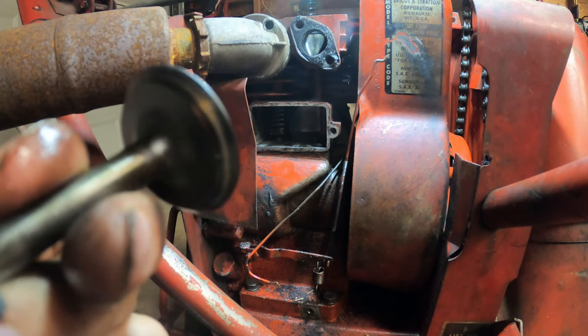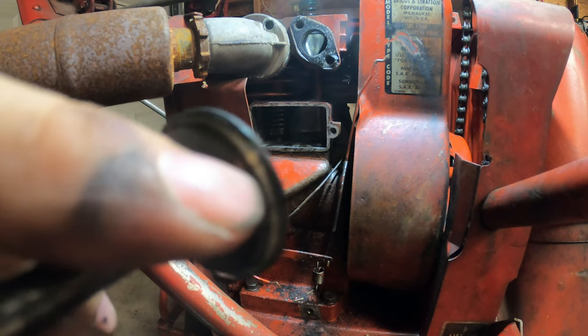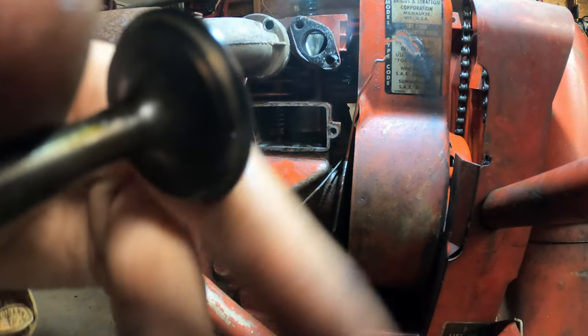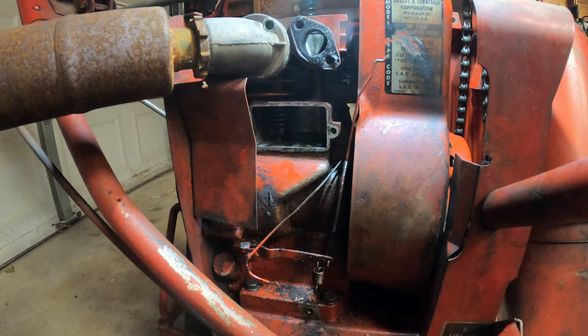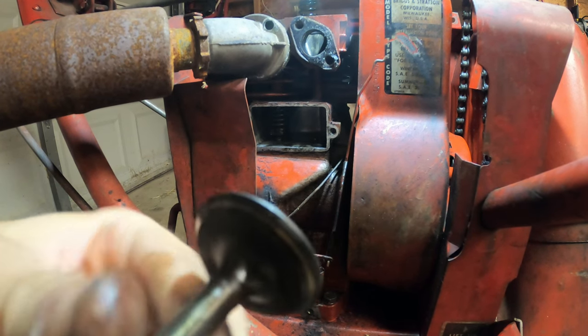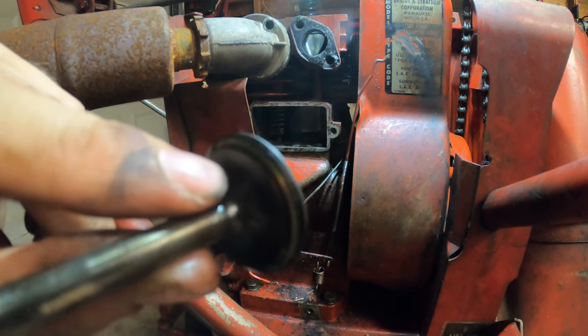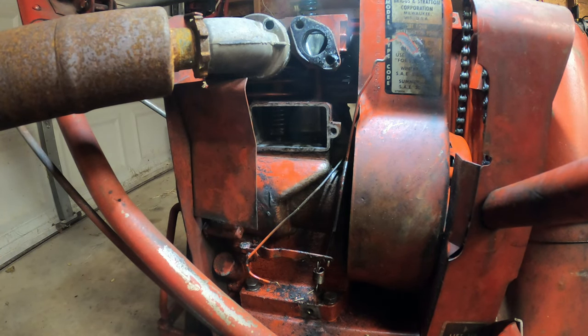And all across the valve face, I think that's what it's called. I don't know 100%. See that little light silver right in the middle? Camera's probably not going to focus on it. But that little light silver is where the valve seals. And going around it, got to make sure it has a good seal. And on this valve, it almost looks like the seal is thinner right there than, say, right there. And I think you can even see that on camera. So that's probably where the leak was coming from.